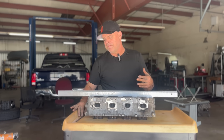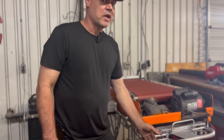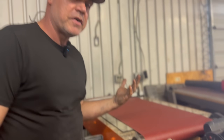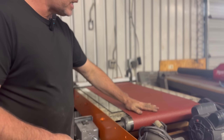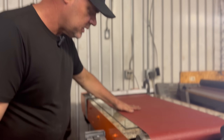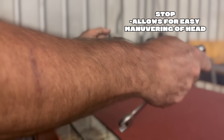It was just a matter of figuring out how to make sure everything would be true after milling — it's got to pass the test with the straight edge and the thousandth-inch feeler gauge. Here we are at the mill. You might notice it's on a gurney — long story. You can tell it's a treadmill. This little motor allows it to incline. My first version was a lighter treadmill and it was fine, but I felt like I had to support some of the head's weight while milling, so I got a beefier one — basically a bariatric treadmill with a stronger motor. This is the sandpaper on it.